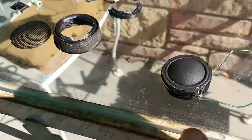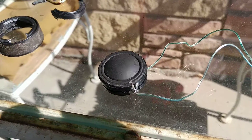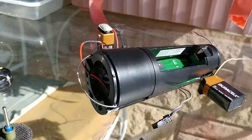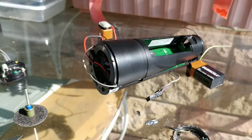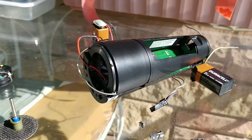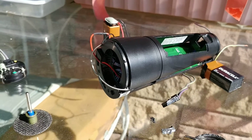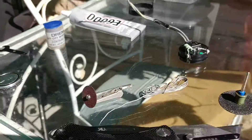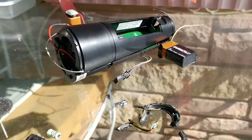This new speaker is at least 8 watts if not 15 watts — more than capable of handling anything this trumpet unit can throw at it. We've already tested it and it works beautifully. If you contact the company and want it repaired, they're going to charge you anywhere from $65 just to look at it to $125 to do a repair, but they're going to put the exact same speaker in it that's prone to the same problem.